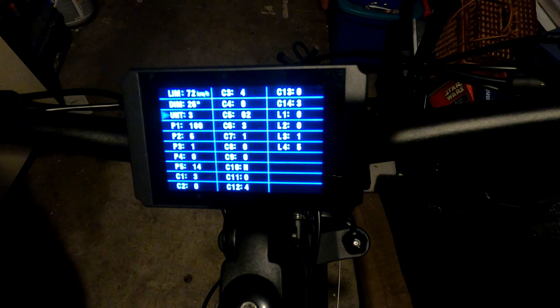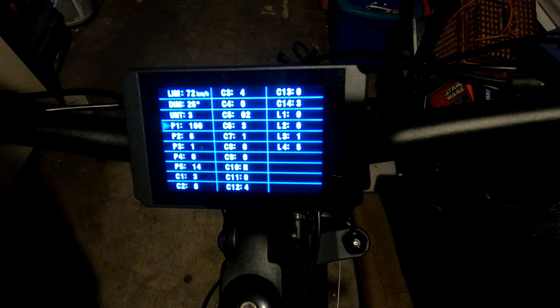P1 is the motor characteristic parameter, determined by your gear ratio and number of magnet poles on your hub. On the Rad Rover — whether it's the stock motor, the Bolton upgraded motor, or Bafang — it's a 1-to-5 gear ratio with 20 magnet poles, so 5 times 20 equals 100. For the Rover, this will pretty much always be 100.